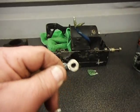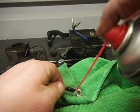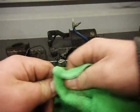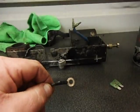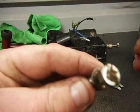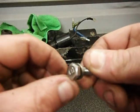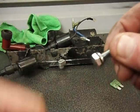Give that a good little clean. Again, with the contact cleaner, give that a good spray all up in here. Give that a good wipe off — this flashes off pretty quick, so once you've wiped it and cleaned it all off it's usually good to assemble it. Obviously you want to clean the bolts up as well — these are what the bolts end up like, absolutely disgusting. So again, what we do is put them on the wire wheel. End up with something like that. These are fixed washer types, so just make sure you're cleaning this bit as well.